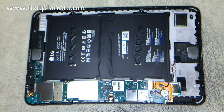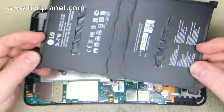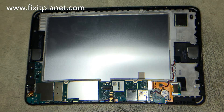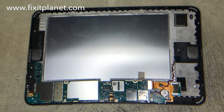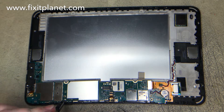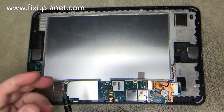That comes right on out. Take a few minutes to just look it over, make sure there's no damage. The tape wrinkles it up a little bit, but that doesn't hurt the battery any — you just need to make sure it's not torn, ripped, cut, punctured, or anything like that. If it is, please don't put it back in — that's a very dangerous thing, it could catch fire. It's not safe.